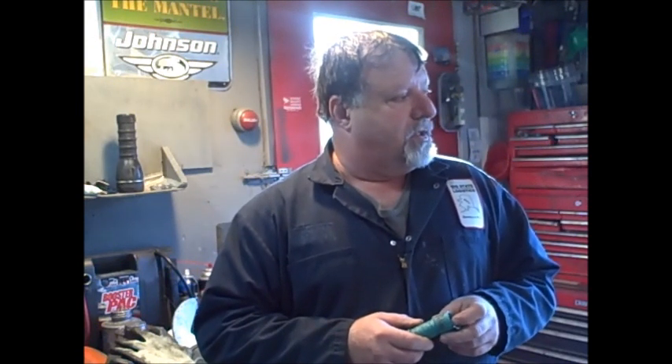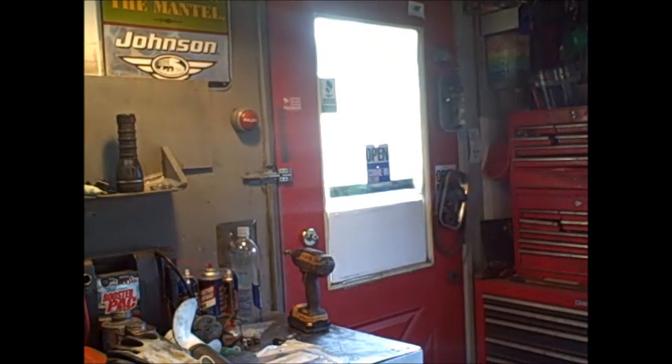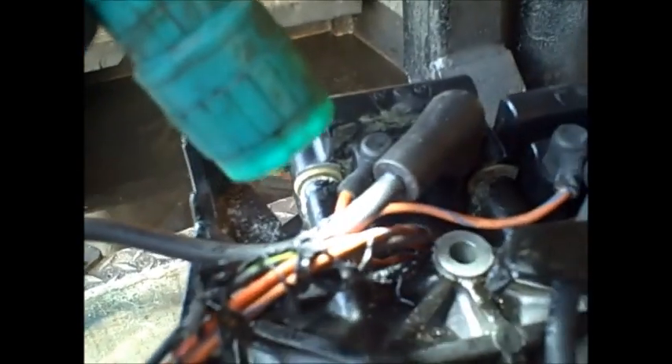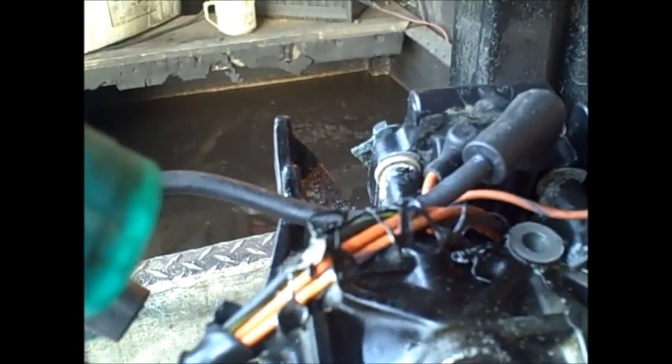It was definitely getting water in that lower cylinder. I'll get the head gasket put back on there and then we'll fire it up and see if it doesn't run a little bit better. Something I found a little interesting as I was fixing to put this head gasket back on — look at this wire protector here, look at it up here — it is just melted. So this little motor at some point in its life got very hot.